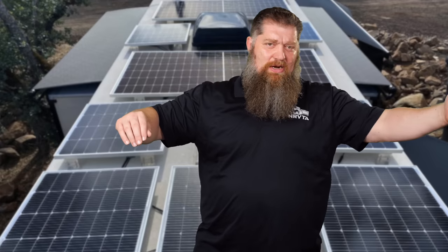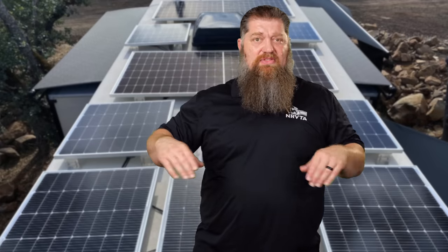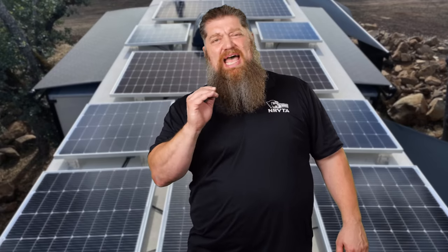Now let's talk about inspecting the seals. Typically, the feet are just beyond the periphery of the solar panel, and I put them on the sides. Remember, we don't have to worry about the sides — I don't put feet at the extreme front or extreme end. So I don't even have to get on the RV. I can look at the sides standing on a ladder and check those feet. I also put more than enough sealant on there so that when I come back to check it, there's still plenty there.